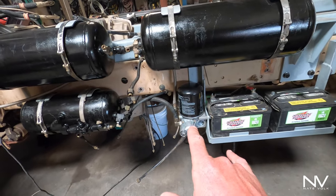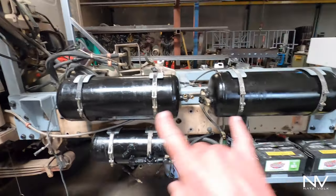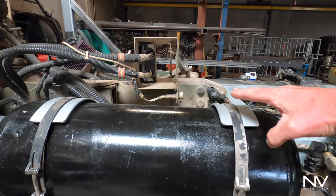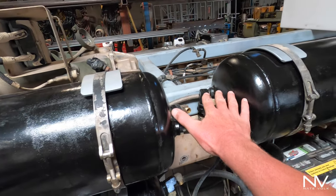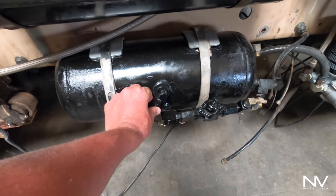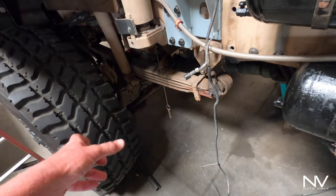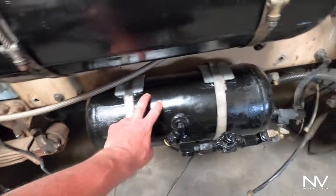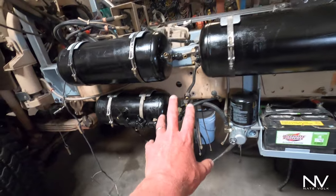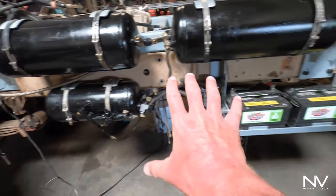I can always unscrew two screws and swap that out with a 24 volt heater for like another 10 bucks. Here is where I put my air tanks — these are going to be up, the cross members are coming across here so there's plenty of room. All the connections are in the middle, the wet tank on the bottom, and I've also got my quick release fitting on this side where I'm going to run an air hose and have another quick disconnect so I can have air from the wet tank for running tools. I've got a couple airlines to lengthen and shorten and mess with, then we get all that done.